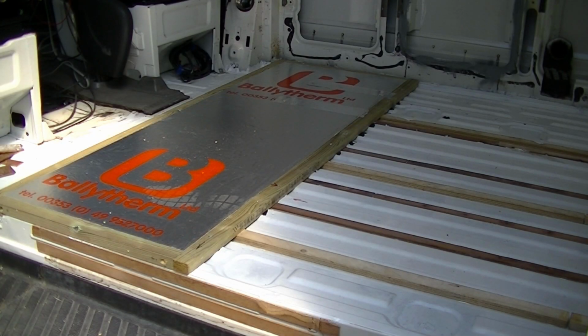So there we are, there's the basic principle I'm adopting. These are 25mm by 38mm standard UK roofing battens. They are pressure treated and they're ideal when dealing with 25mm thick PIR, because it's exactly the right size. If you buy planed or round timber, 25mm is going to come out at 22, maybe even less. It's undersized.